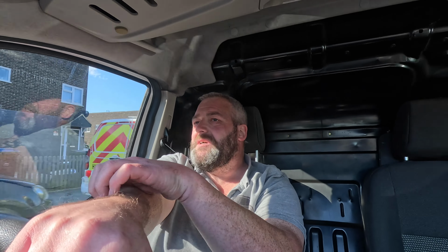But that's a great little technique with a tape there. Because when you do tunnels and stuff, they flap about everywhere, and where that tape's rigid, it's really, really good. And by going the other way with your clear, it just leaves a very fine bit of clear in there. I find it a lot better than the way that I used to do it, but I've got to do some more. I've only done it a couple of times, so you have to get used to and familiar with how you sort of go about it. But it came out right, the results were good, the colour was good. Magnetic grey can be a bit of a nightmare, to be honest. But colour went in good on that one.